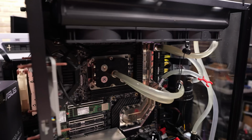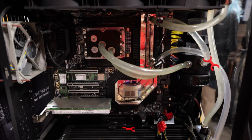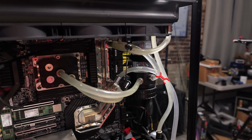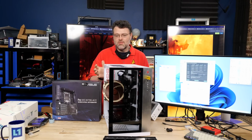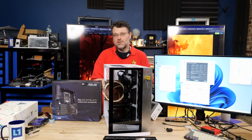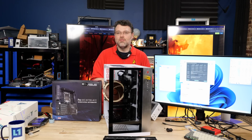It's pretty nuts. Having used the W3175X system in the XL version of this case for so long and experienced some issues long term from that 24/7 overclock, namely curling at the edges of the processor. When that processor runs hot for a long period of time, the corners of the processor want to lift. I experienced that issue when it was still under warranty because, you know, I bought the CPU, which is just a whole other level of madness.